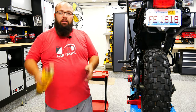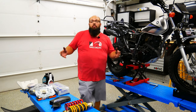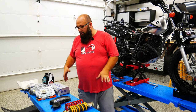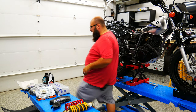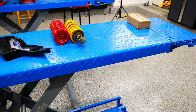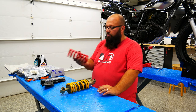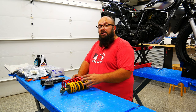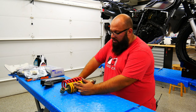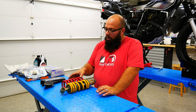So now let's get to replacing the actual spring. The cool thing about working on a bike on a car lift is you've got this other table slash workspace right next to you, so I'm going to raise this up so I'm not bending down. The yellow one is the stock one and the red one is the heavy duty one. The yellow one has a thinner gauge steel and looks more of a progressive style coiling, and this one is an evenly distributed coil.